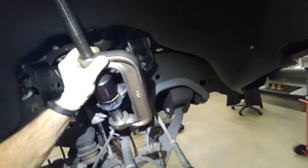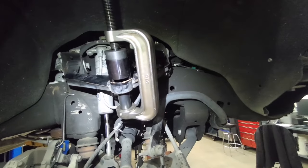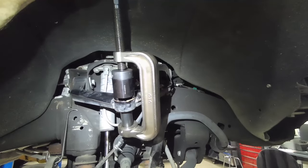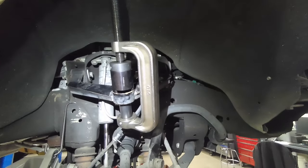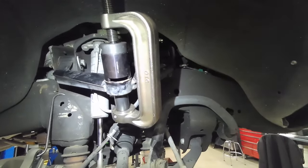The reason I'm using two sets is the lower ball joints on these GMs have a crimp swedged section on the top of the ball joint holding it into the control arm, and they take a ton of force to get out.